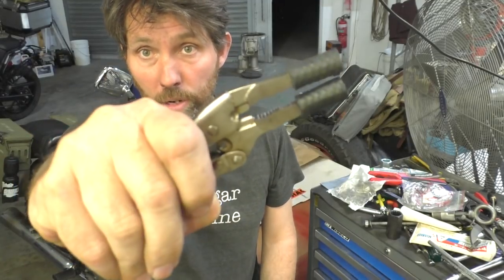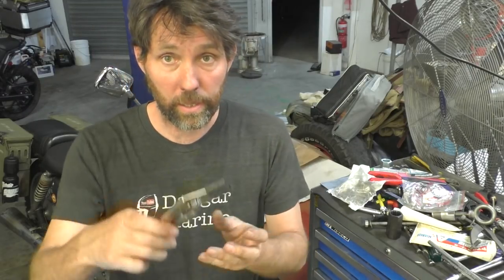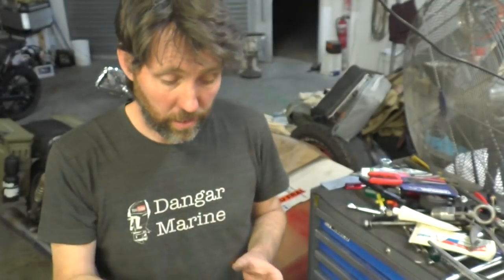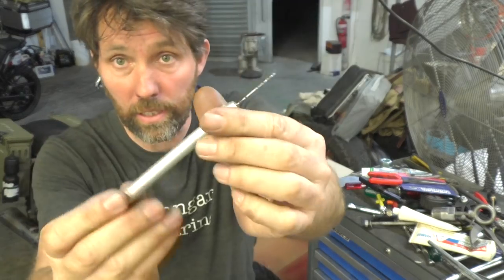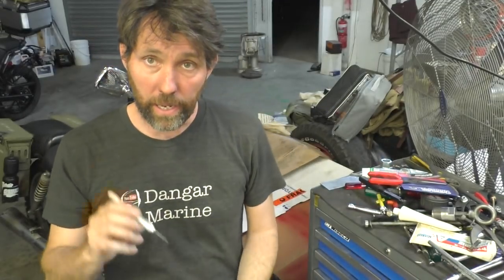This is just a little set of vice grips that I've put some fuel line on the end of, so you can crimp off fuel lines and stop fuel running out without damaging it — as Eric the Car Guy once said, nothing ever goes wrong when you have hose on hose. I've also got a variety of O-rings, thinner ones for like the backs of carburetors, though it's really hard to keep all the types you need. This is just a little hand drill — drill bits go in a little hand collet. Really good for clearing out the pitot tube on the front of the gearbox that your speedo drives from, so that's worth doing each service too.